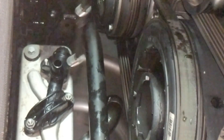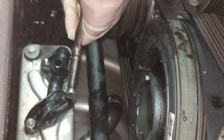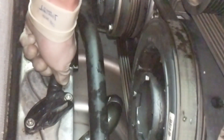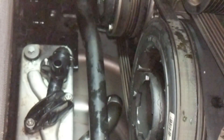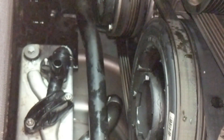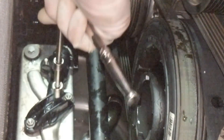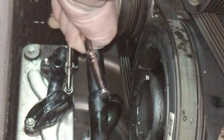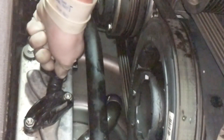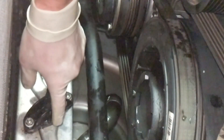I do have a pan and filter set up on the way for this. Instantly coolant starts rushing out. The cooling system is drained underneath at the very bottom — it's the lowest point — and you take off one of the hoses and it drains. But apparently there's still coolant in this heat exchanger, which kind of sucks because I really don't want coolant getting mixed with the transmission. Loosening it a little bit and pulling up, trying to get as much of the coolant to flow out and stop rushing out before breaking the seal, because the ATF is on this side.